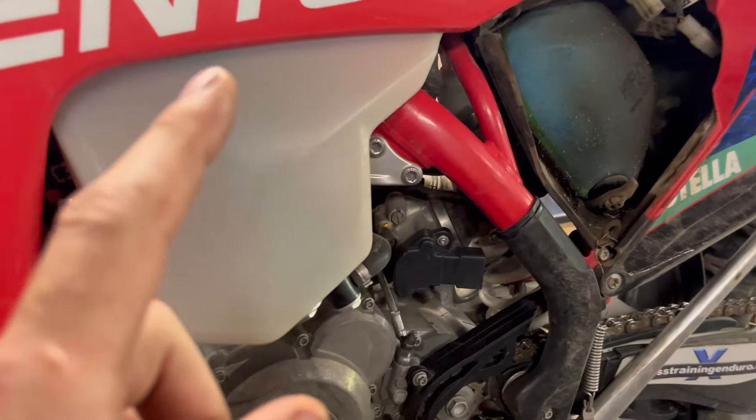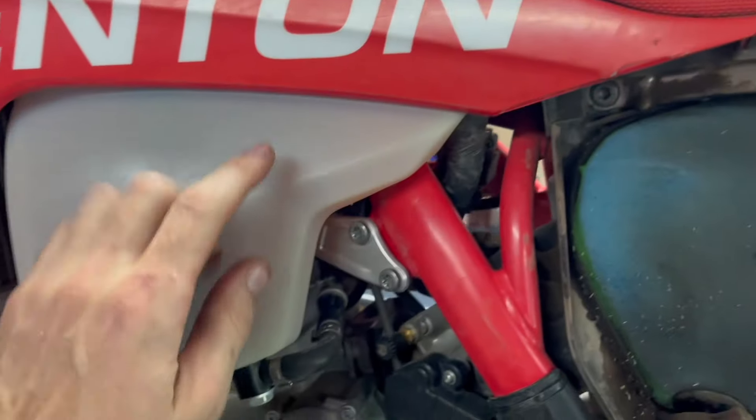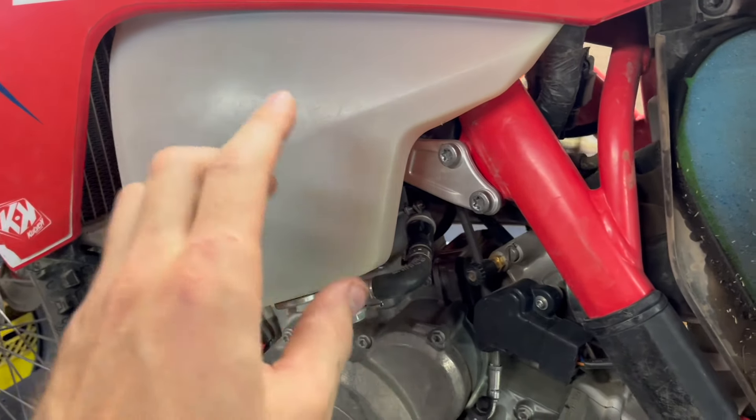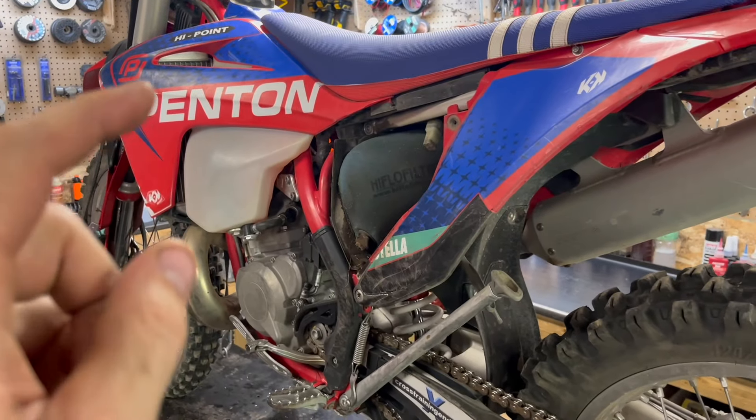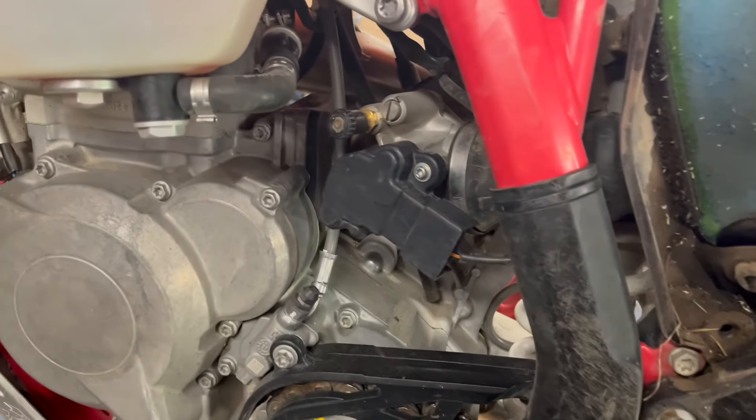This one's the top end. I put the TSP ECU and head medium compression on at about 35 hours, and then at about 50 or 60 hours I put in the injector relocation kit. I've made a ton of mapping changes — I've gone all over the map so I really don't know what to expect with my piston. I've got the bike really hot; the hottest I saw was 263. It's been all over the place so I'm really curious to see what the top end looks like.